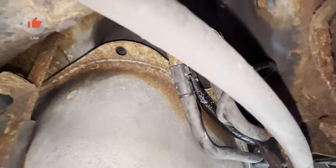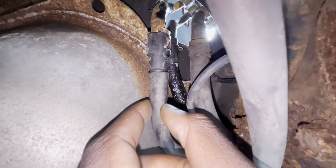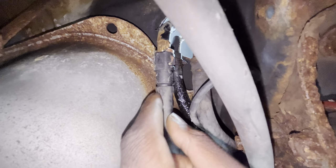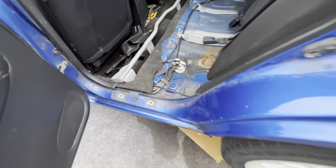What I've pretty much decided to do is — if I can't take this quick connector off — I'm just going to cut from right here all the way to where it goes up there, and just replace that section with a proper fuel hose so that this doesn't happen again.